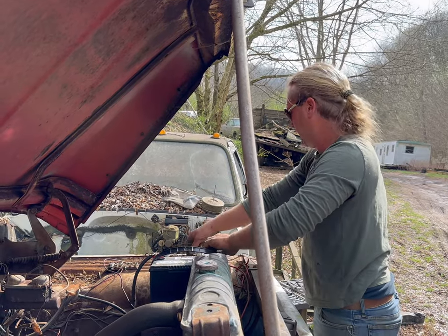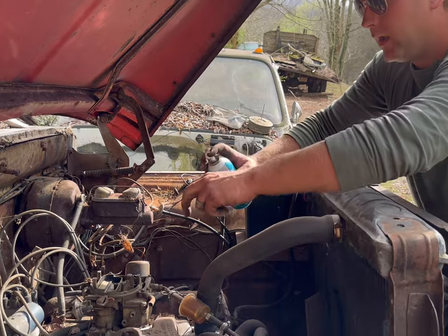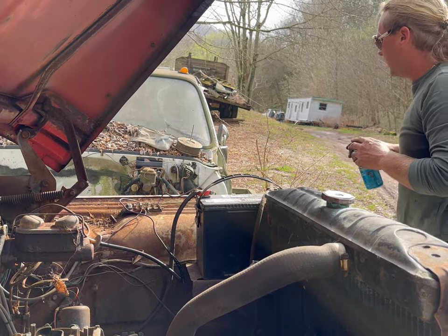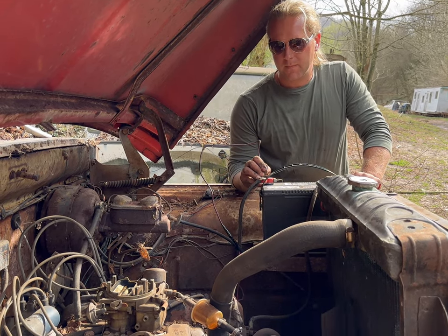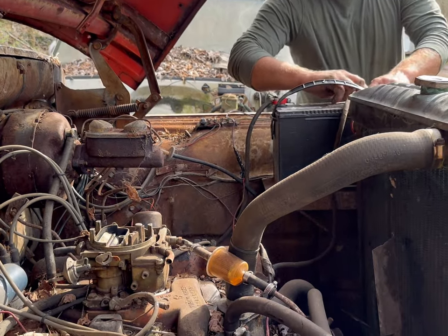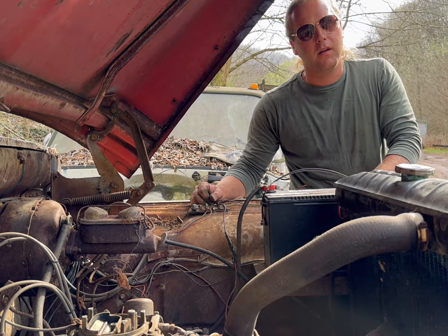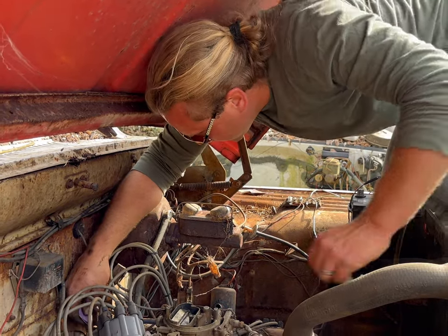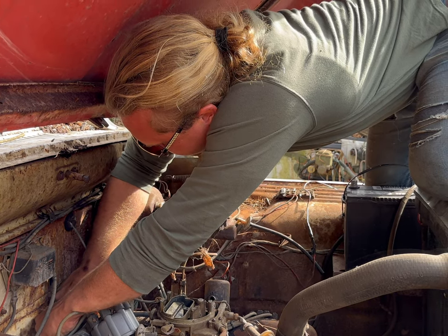Now, let's see if we got anything at all. All the points are fine. If the coil's any good, which most of the time, if the coil's not any good, it's not going to fire the points as a general rule of thumb. So, if we're lucky, we'll have lots of fire in just a second. I don't think it's gonna let me get away with it, so I'm gonna actually have to find me a piece of sandpaper and get down in there and clean those points so that they arc properly, which is what you should do. Don't be cheap about it, just get it done. Like I said previously, don't cheat yourself. Try to do a good job, especially if it's for somebody else, but if it's your stuff or whatever, because the only thing you're gonna end up doing is cheating yourself.